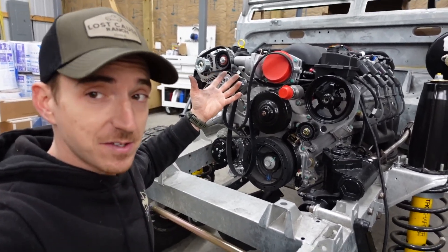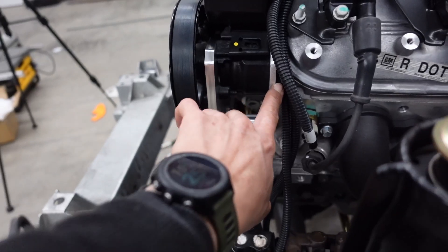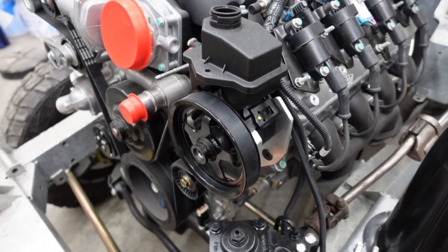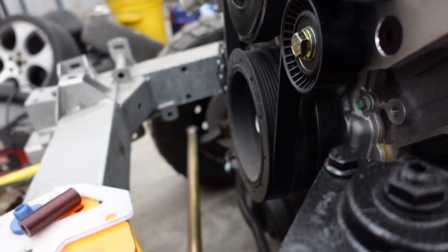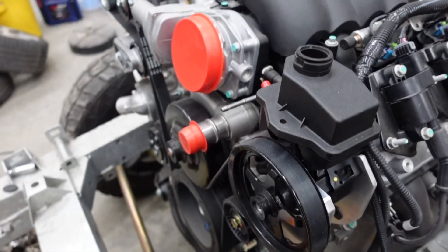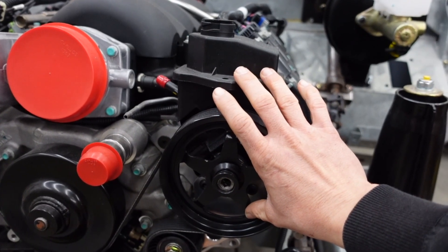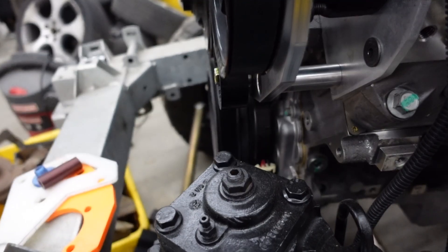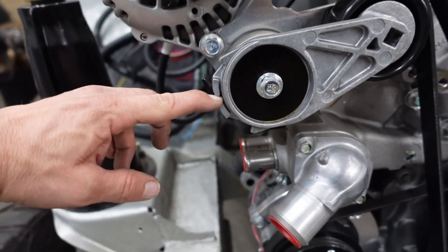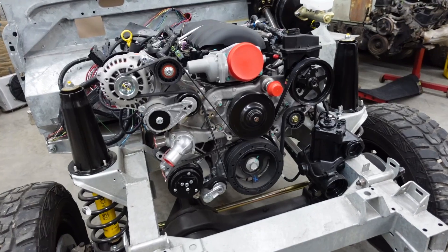Let's throw the belt on and see if everything lines up. Everything looks nice and true right along there — we're not pulling away from the cylinder head anymore. The aluminum is much stronger than the plastic. Our big dilemma was that we have a Corvette crank pulley; the truck-style pulley is like two or three inches further out, which would leave plenty of room to stick the power steering pump up top. But with our very low profile front drive, there was nothing off the shelf that worked. Now that we got everything fitted up, we will probably have to shrink the belt size down just a touch — we're almost maxing out the tensioner. But we also confirmed the correct length belt tensions correctly, so that's an easy enough fix.